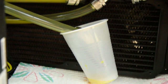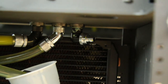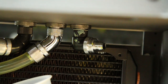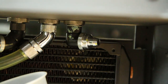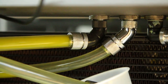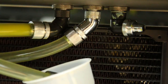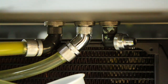We got it all bled. I got the fitting off — put a cup there in case it drips, and as you can see, it is dripping. There's the bad fitting. You can see we even have a little bit of staining on there. So we're going to get that elbow out of there. I'm actually going to be putting on a dual rotary fitting — not a sharp 90 like that, but like that black one on the left right there. Although it's going to be a chrome one like the one in the middle, because I don't have any black ones, believe it or not.